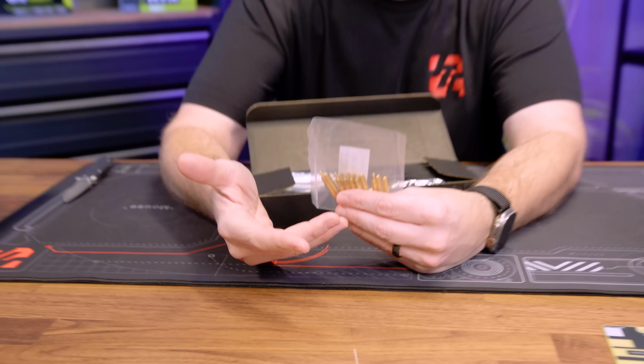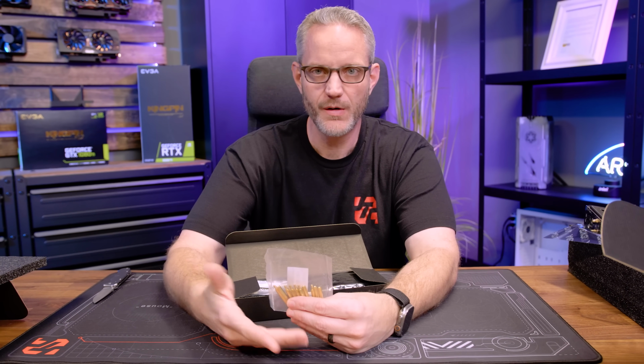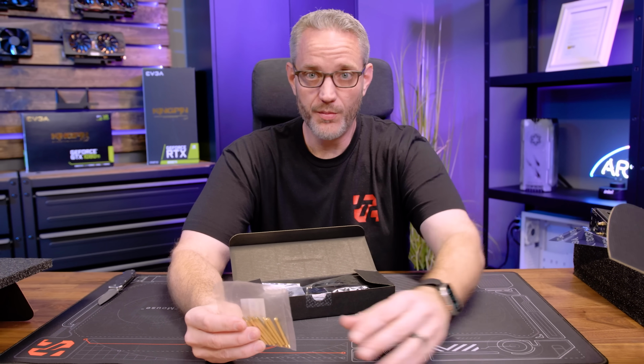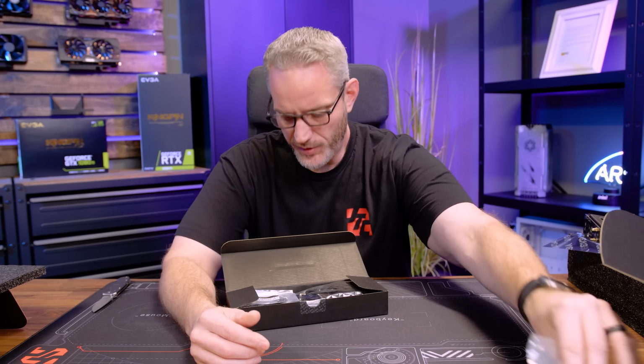Again, LN2 overclockers understand the importance of keeping the backside of the socket from freezing over, so you could have room to run a heater there, cables under there, you can sit drives under there, or whatever. It also allows more airflow underneath the motherboard, which is something to consider too when you start pushing a stupid amount of voltage to the CPU.